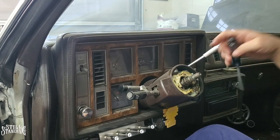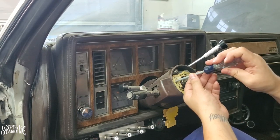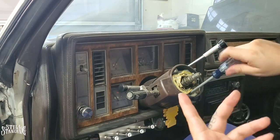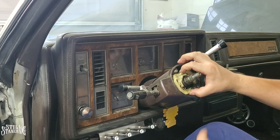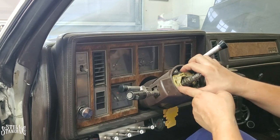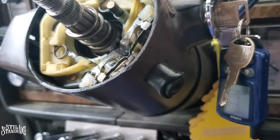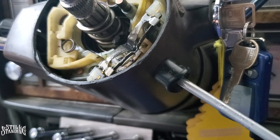In order to remove the top one, I've got to switch it all the way down. It's kind of tedious to show but hopefully this helps somebody else out there trying to replace their turn signal switch. Like I said, I have the patience now to take my time and do it right. Also, I just noticed I have to remove the hazard switch here as well — it's a Phillips screw too.